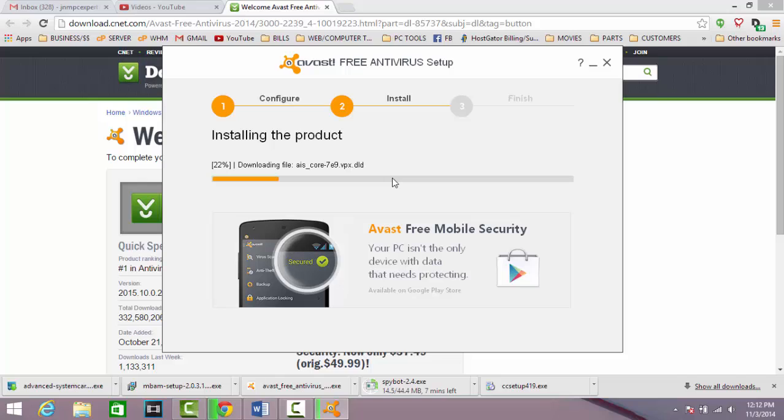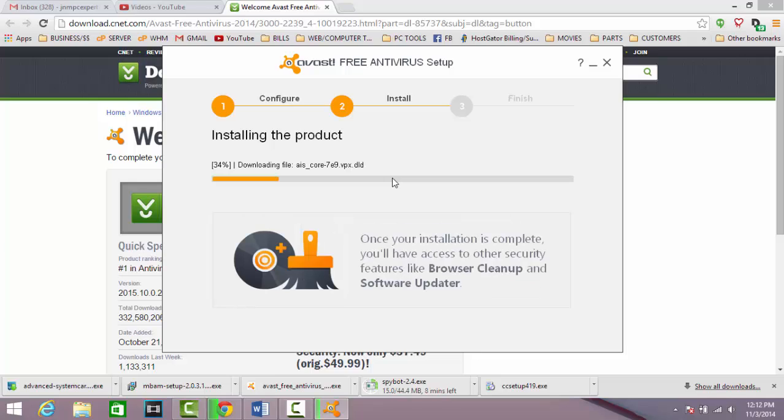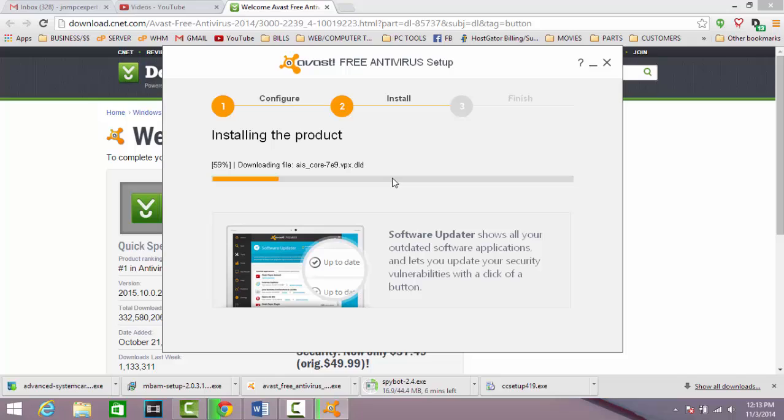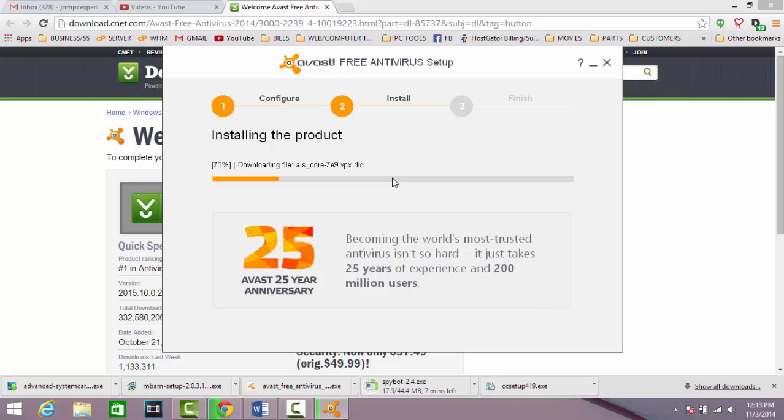And Avast has what's called a boot time scan. There was another program that had a boot time scan, but it wasn't very thorough. This one I like. It's very thorough, and it's nice because a lot of threats will actually hide inside Windows or behind Windows so that your program, while Windows is on, can't detect it. Whereas the boot time scan takes a long time, but what it does is, once you schedule a boot time scan, your computer will start to boot up, Windows will just start to load, and then Avast intercepts it, pauses Windows loading and runs a scan.